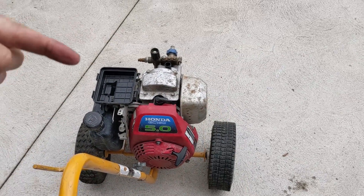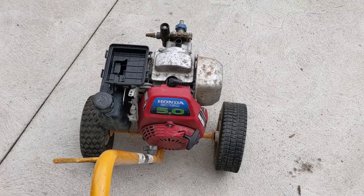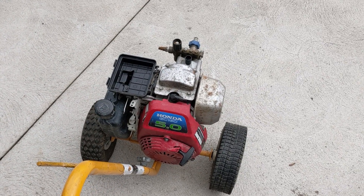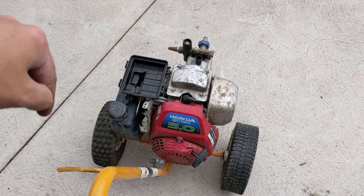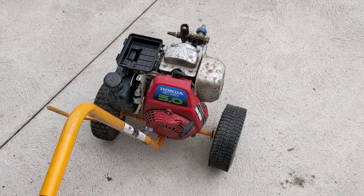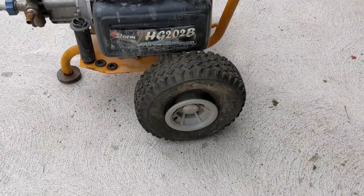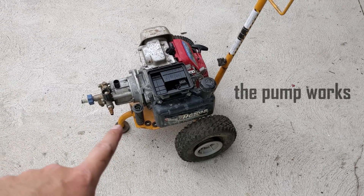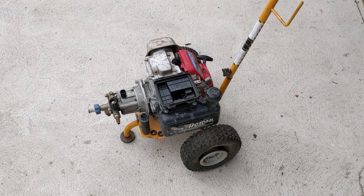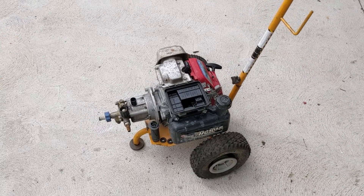There's a little bit of smoke, probably from oil that was in the top end since I had this tilted on its side, but it runs now. When you engage the choke while it's running, it creates excess suction that is sometimes enough to pull out any clogs in the carburetor. It doesn't run perfectly, but the customer probably doesn't want to spend a lot of money. The only things I added were a little fresh fuel and some RTV silicone. The reason the intake valve seized was running the engine on low oil — don't run your equipment low on oil or you can seize a valve.